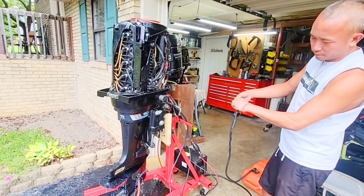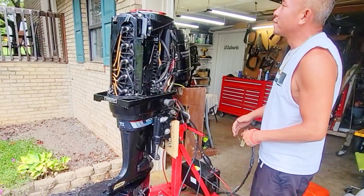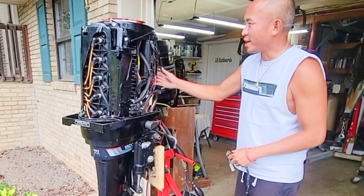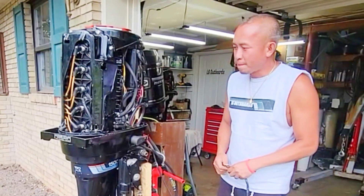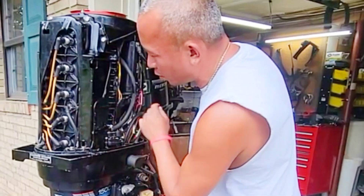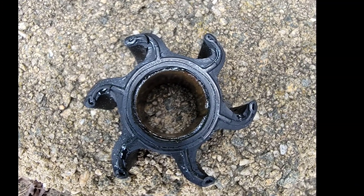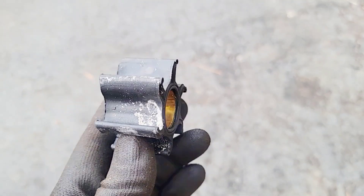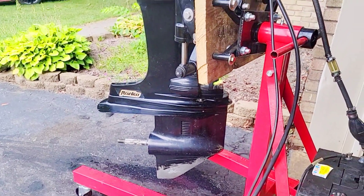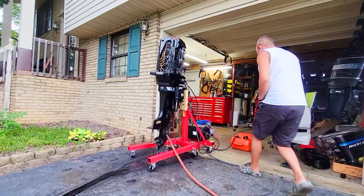Obviously it needs a brand new impeller, so I'm going to do that. As far as I can tell this is a monster piece. The tangs were set correctly without measurements. It would be a great engine for somebody. We've got the cooling system in check and we are good. I changed out the impeller — this one's obviously no good. So we're going to crank again and it's going to pump water because I put a brand new impeller in there.